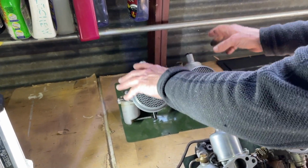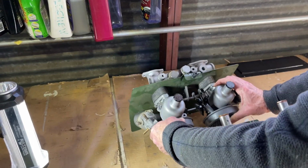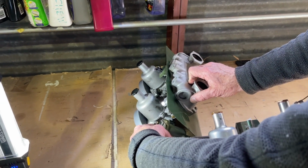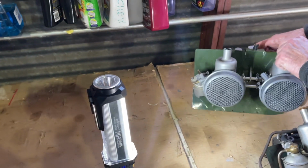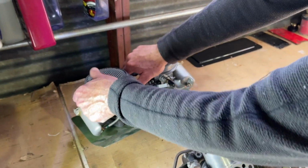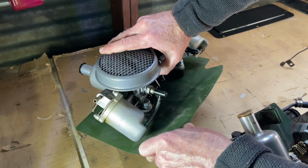This is another HS2 assembly, but it happens to be fit with the original Bugeye air filters, which is not something we recommend because you actually have to damage the body to fit that bolt in there, and they're really a pain to turn those hex heads when you do this. The better setup is to use the K&N filters that we sell for these HS2s. You also get much better filtration. But once again, on these carburetors, which is another used set, first high idle, and then you can see the jets deploy, and that's where the richness comes in.